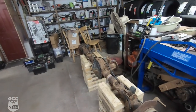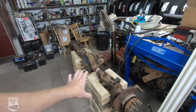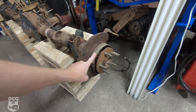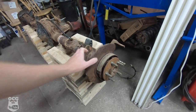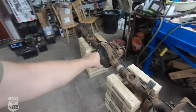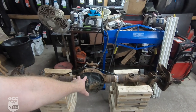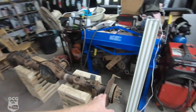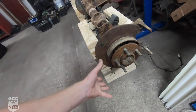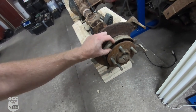First things first — she's rusty. Believe it or not, this came out of a 2011. One of the things I noticed right off the bat is that the brakes have been exposed to the elements and the backing plates are all bent to crap. So one of the things we're going to do is drain the differential and pull the little keys that hold the axles in place so we can take the axles out. We'll be replacing the parking brakes and all the hardware inside, and to do that you've got to have the axles out, otherwise you're working in a really tiny area.